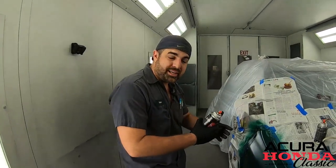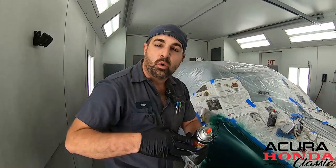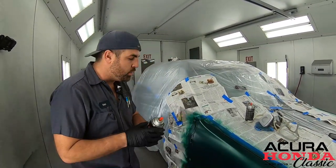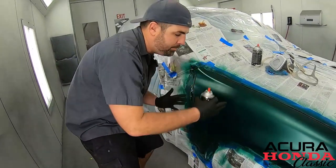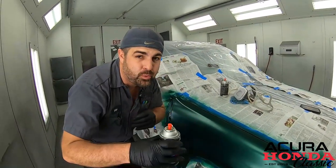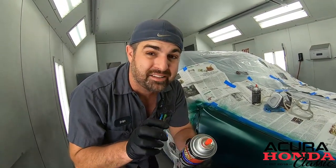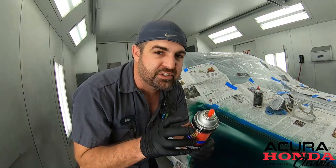We're going to do our third and fourth coat all in one step. Originally we did long strokes, but it's very hard to keep it nice and even with long strokes. So on this third and fourth coat, we're going to do parts — one part, two part, three and four — and we're going to move really, really quick to keep it nice and wet. It really helps to do this in the cooler hours of the day so that paint doesn't dry so quick. If it's going on wet, it's going to be smoother. Dry spots on your fender are going to be streaks.